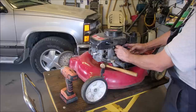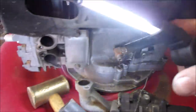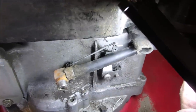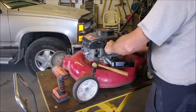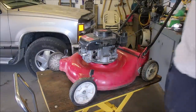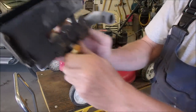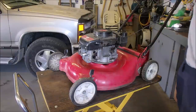Oh yeah, he's got this in backwards. How in the heck did he do that? He's got that bar in there from the throttle — in backwards from the back, right there. It's like pulling a tooth. So that's the piece that fits right into the carburetor, and the gas line goes on in. So I'm already not trusting it. If I get some numbers off of it, maybe I can match it up with something I've got.